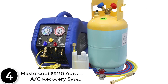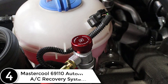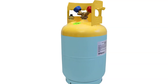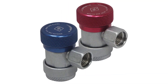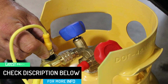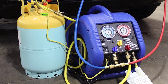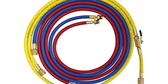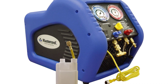At number 4, the Mastercool 69110 Automotive AC Recovery System. Mastercool's certified automotive AC Recovery System recovers and removes oil from refrigerant. This system is compact, lightweight, and works with all refrigerants, and ensures automatic shutoff when the tank is at 80% capacity. Connect the yellow hose to the blue low-side fitting on the DOT tank to allow quick removal and transfer of refrigerant. The system pulls refrigerant from the vehicle using both high and low sides simultaneously. Connect the oil drain bottle when the low-side gauge reads approximately 10 psi, and disconnect it when it reads 2 to 0 psi. Do not leave the oil bottle connected, as the oil-less compressor will start to pull a slight vacuum.